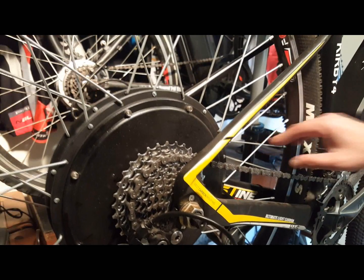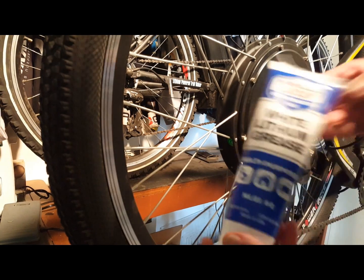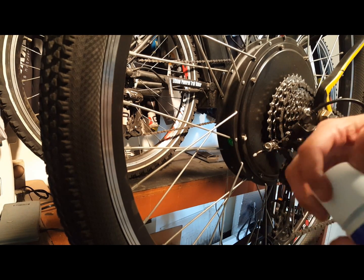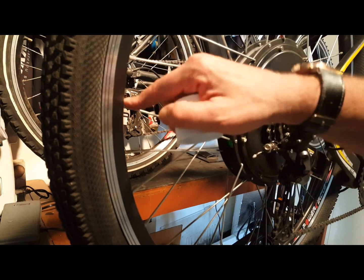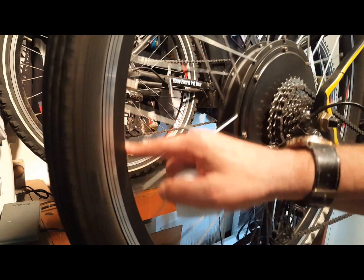When the motors leave the factory, there's a lot of tension on the spokes. In order to help break in the wheel, apply a good bike grease lubricant to each spoke where it attaches to the rim. Make sure to really push the grease in so that it goes inside the inner wall of the rim. You'd only have to do this about twice a year — it reduces metal-to-metal noises and helps lubricate your spokes.